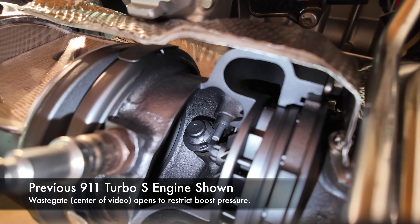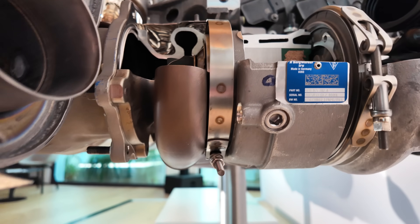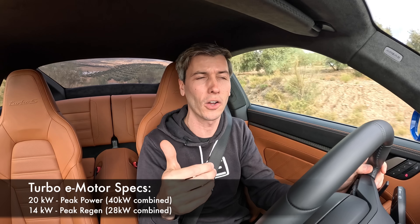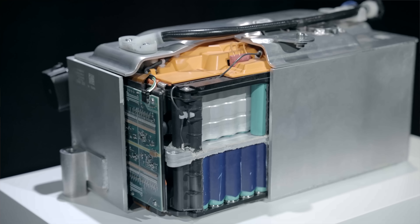Advantage number five: no wastegates. You can eliminate wastegates entirely — and this differs from some manufacturers. Mercedes has an electric turbocharger application but still uses a wastegate. Here there is no wastegate. These electric motors can be powered with about 20 kilowatts to spool up, or they can recuperate about 14 kilowatts each. Because they have so much power to recuperate energy — effectively acting as a brake on the exhaust — you use that to set your boost level. If your torque target needs 10 psi, the second you get to 10 psi, the turbo acts like a brake keeping the turbo spinning at a speed that doesn't exceed that torque level, and you send that energy back to the battery.